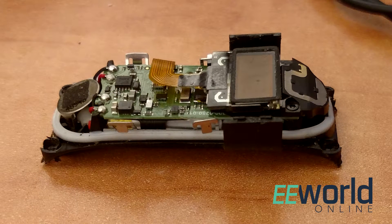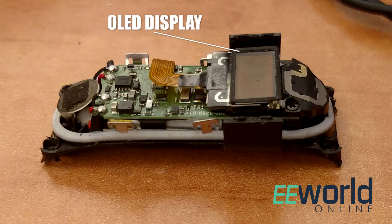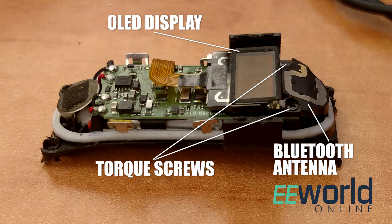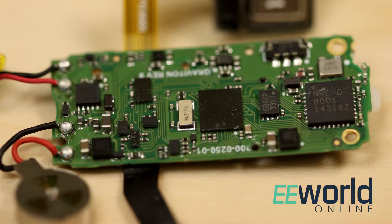What about the other side of the board? That side is more populated and a bit more interesting. When you first pop the plastic cover off the Fitbit, that's the side of the board you see. The OLED display sits on top of it, pressed against a piece of plastic that both supports the display and doubles as an antenna for the Bluetooth connection. The metal bracket, which serves as a supporting frame for the recharger cable, also helps keep the OLED readout stable. Adhesive attaches the OLED to the Bluetooth antenna assembly, and the antenna assembly is held to the circuit board by two super tiny Torx screws. When you unscrew those, you release part of the antenna assembly supporting the OLED, and the rest of the antenna assembly can then be pulled off to reveal the components on the board.